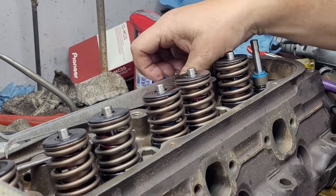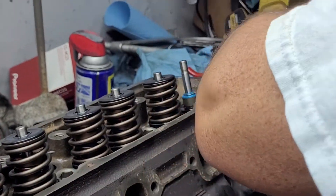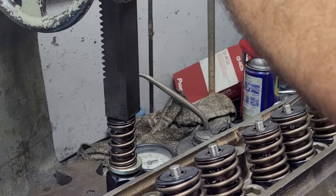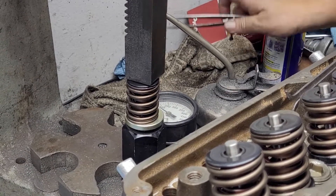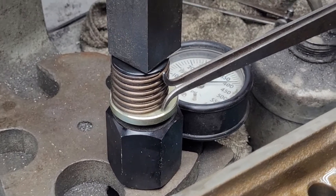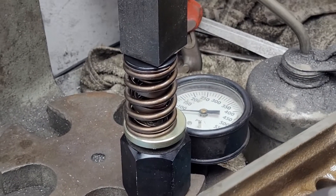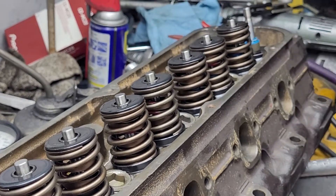At whatever this distance is right now, we set up a second set of calipers for that. This is our last spring, so let's just check our load here — it should be good, about the same as the last one. Now I really lean on it and compress it — that is the most we can expect, that is actually when it comes to coil bind, which is about .600 lift with our original 1.71 installed height. Well over 350 over the nose, more than enough for our 6500 RPM max — and we know he'll be running 7000 plus at some point.